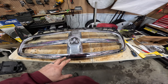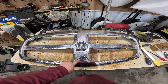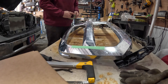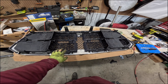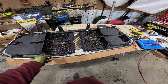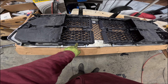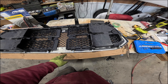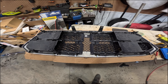So with the grille out, you gotta take the back plastics off of it because unfortunately this is a destructive installation — we do have to cut this part out and this part out of the OEM grille and reuse the outer ring. This part here does not actually go back on, but I wanted to keep the cooling for the radiator so that doesn't get affected. I made them fit again using a hole saw to cut out where the nuts go for the Rough Country grille. A couple of the clips up here don't work but they get held in by the bar anyway, so everything is tight and secure.